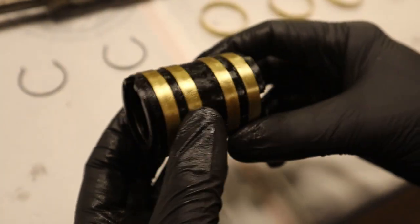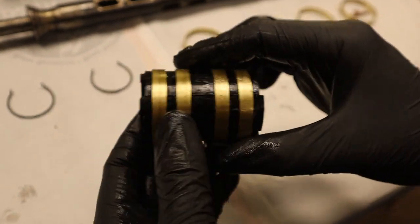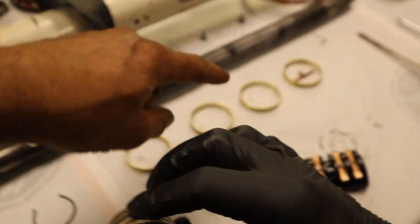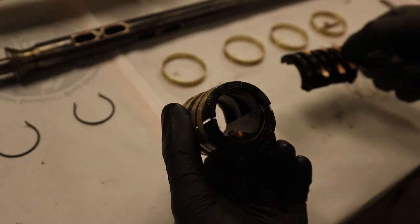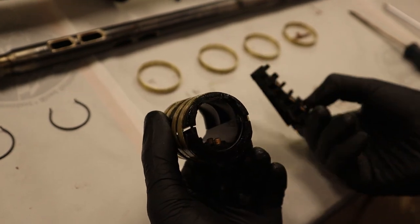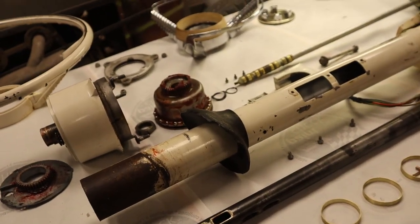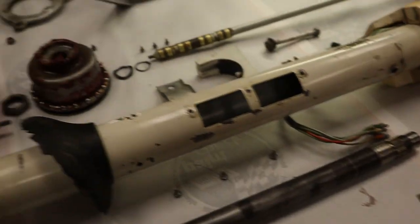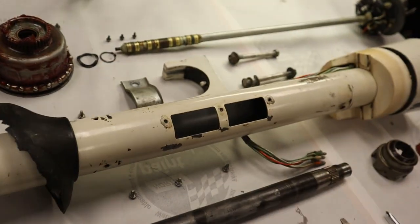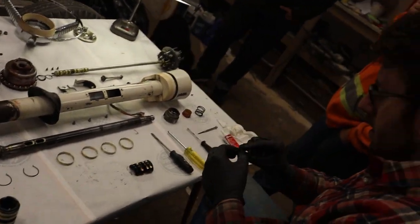Yeah, believe me. Completed selector ring assembly. Nice. With contacts. So the contacts are the little springy things, and there's two of those, and they sit both on the shaft, separated by a spring to index them. Is that correct? So we're going to let you put the other one together, and then when this all goes together, we will rejoin.